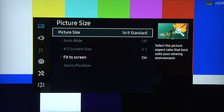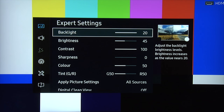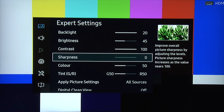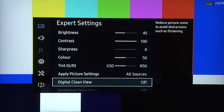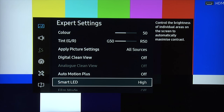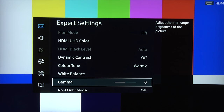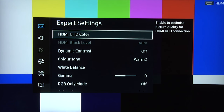Make sure the fit-to-screen is on. Now, although it's movie mode, this is a different group of settings to the previous ones — that was for standard dynamic range content, this is for HDR high dynamic range content. Going in, you'll see that backlight is now 20, brightness 45, contrast 100, sharpness still at zero, color still at 50, tint still at its default, digital clean view still off, auto motion plus still off for film-based content. Smart LED is set to high. Dynamic contrast: off. Color tone: Warm 2. Gamma is at 0. Color space set to auto.